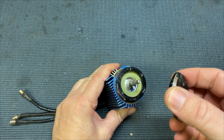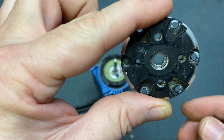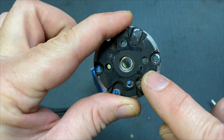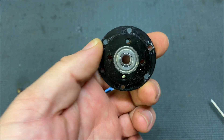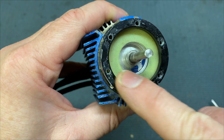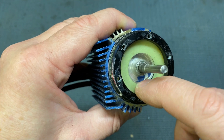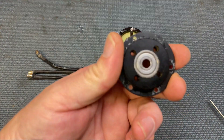See if we can get that front off now. There we go, it just pops off. As you can see, these holes here go straight through into the motor. So there's no waterproofing — there's no seal on there at all. This is the bearing that had gone funny. What there is inside is like a gasket here, which just stops the dirt and crud actually getting properly into the motor. But the water still gets in and can still get to your bearing.